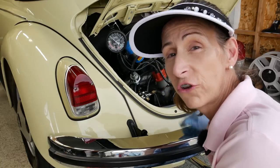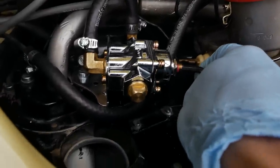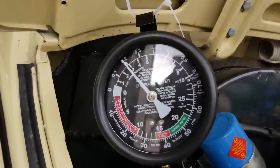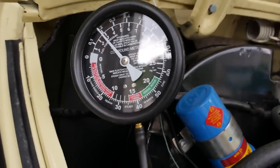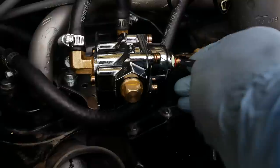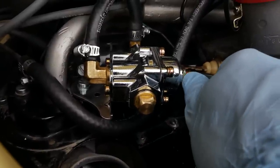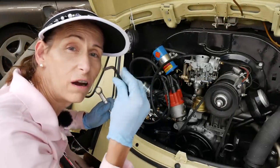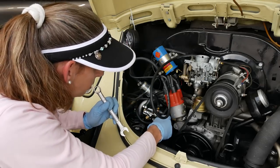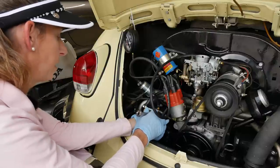Even at speed it's holding true, which is super awesome. I've got an allen wrench in here — that's how you adjust this thing. As you run it in, the pressure goes up a little bit, and as you roll it back out, the pressure rolls down. It's not super responsive, so once you have it where you want it, lock it with this nut on the end — that's a 16 millimeter. Be careful though, it's not a great nut and it's easy to round over the corners on it.